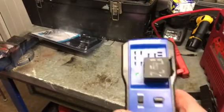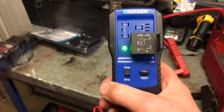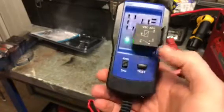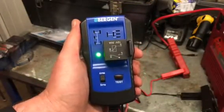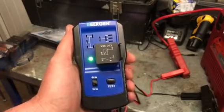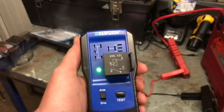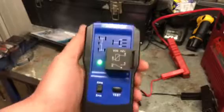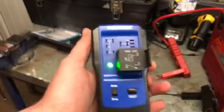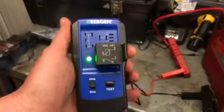It's coming up green again. I'm pretty sure this is a known good relay, so I don't have a bad one to test with, but I'm confident that when I do have a relay issue it will flag it. It's got to be better than taking relays apart, wiring them up to 12 volts to get them to click, and trying to find continuity with a DVOM — all tangled up. Four-pin and five-pin covered; I'm sure there are better versions out there but this does the job.